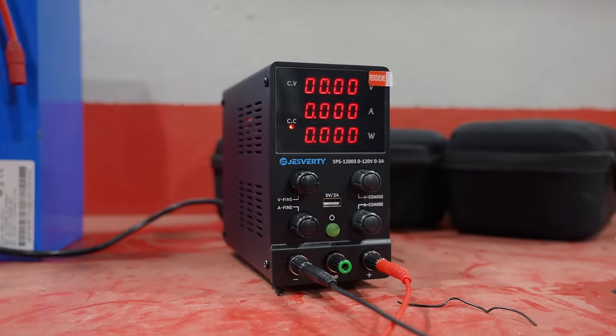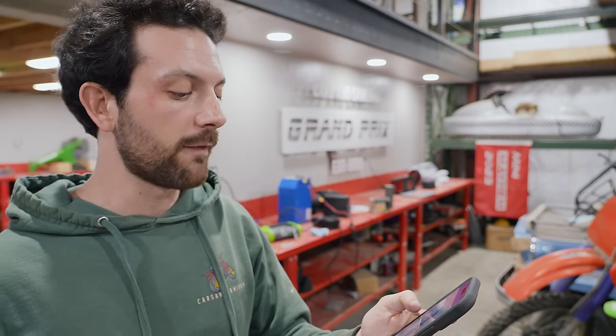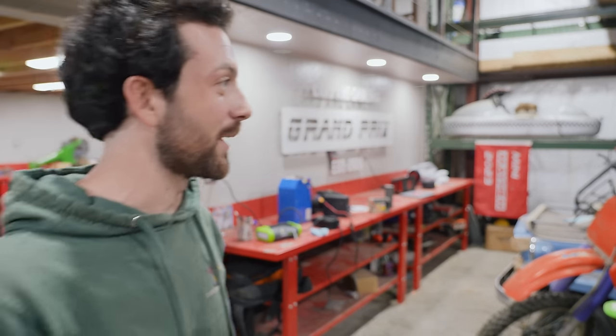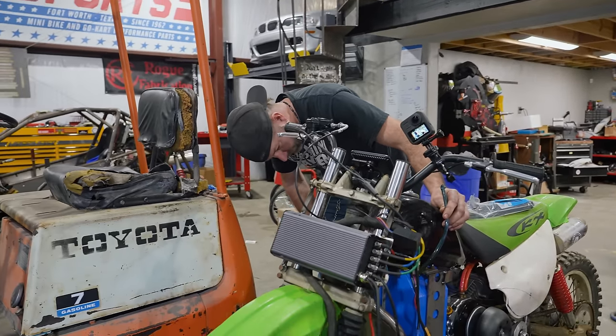That sound coming from behind me is the sound of success. We had to put our battery into a recovery mode and use a manual power supply to get it to begin charging — the battery was so low on voltage that a regular charger didn't even recognize it. I have the BMS open now, we're at 85 percent, a total of 79 volts, right around 4 volts on each cell. I made sparks like three times this morning trying to burn the shop. Long story short — we're ready to bolt this battery in and give this another shot.